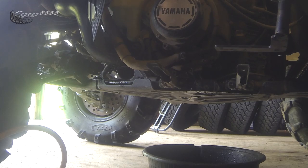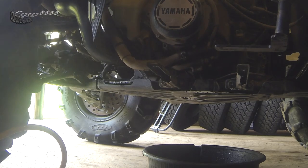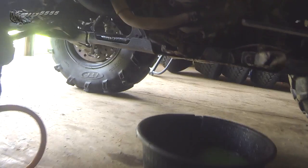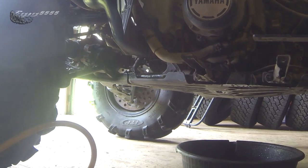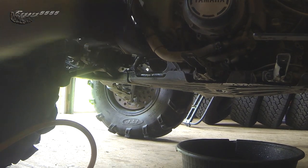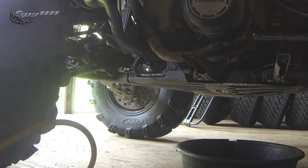Now that we've got it all drained, you could clean your drain pan out beforehand — this one already had oil in it so I know I'll see some black spotty stuff in the coolant. But if it looks like that in your reservoir bottle with all those little black spots, that's an issue — it means you've got a major problem and you're probably going to have to replace the main seal. I do have a video for a Rhino 700 that shows me replacing the main seal.